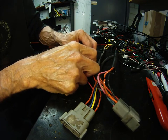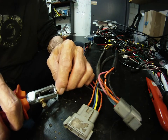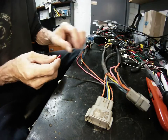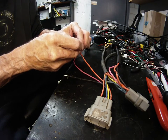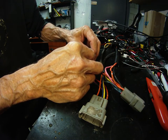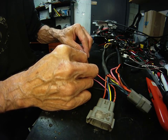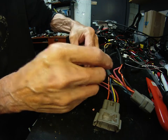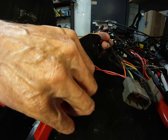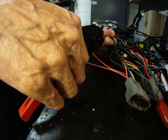Now this one — this is the remaining one. Just knock the end off that, and we might take a red one here. It fits over tight there, and then we've only got one leg to go in there, so we shove that in there and give it a crimp. I don't know how I used a blue one on the other one, but it doesn't really matter that much if you haven't got a red or a blue one.